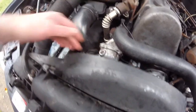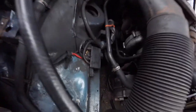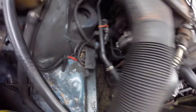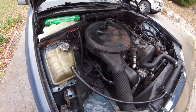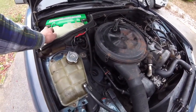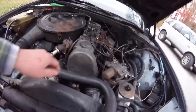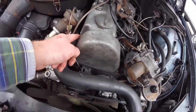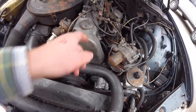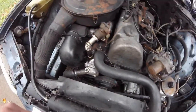This one's a real pain to do just to get around, because you've got to take that off, which is kind of a pain to get back on. I'm going to try to do it while avoiding taking this tube off. New overflow cap because that one was pretty corroded and dry rotted. New pump for the washers. New wiper blades — easy stuff. New valve cover gasket, and I put some washers on the nuts here because I wasn't able to get it tight enough. You want it snug, pretty tight — you don't really want to barrel down on it.